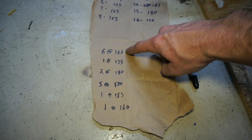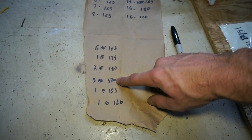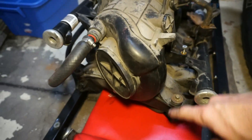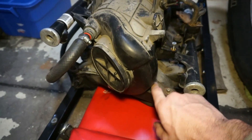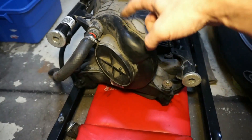So I'll be able to build a full set out of that. 165 and 170 — that's only a 3% difference. So what I'm probably going to do is take the six at 165, and then I'll take two of the 170s, and I'll put them in cylinders seven and cylinder eight. Because 7 and 8 are the rear two cylinders, they usually do get a little bit warmer inside the engine, and these are the two rears. So number seven...